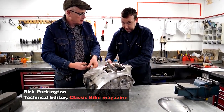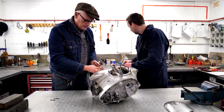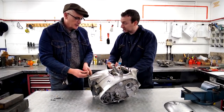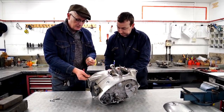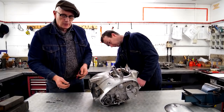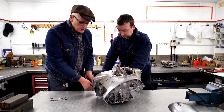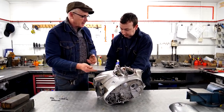It's quite common to find stripped threads in these. People overtighten them, or the other issue is that over the years so much sealant is used — it gets pushed into the back of the threads and cracks the aluminium. These engines use quite fine threads into the aluminium on this particular model, so they're not the strongest when it comes to overtightening. Over the years a build-up of gasket sealant gets in the bottom of the hole — it's a blind hole — so as you screw in, you're compacting down on that sealant and the next thing you know you've either cracked the casing or stripped the thread. It's almost a hydraulic action.